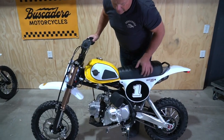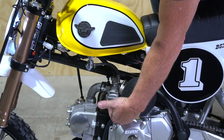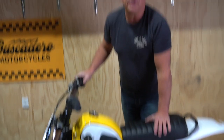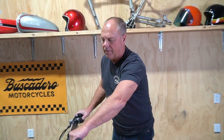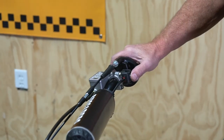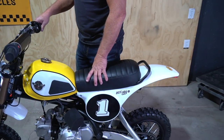This is a brand new motor, so it needs to break in a little bit. It also takes a second for the gas to fill up the float bowl, so don't be alarmed if it doesn't start right up immediately. The break-in for the motor is really important — you don't want to do high revs or work it too hard until you've run a tank of gas or two through it. Once you've done that, have at it.